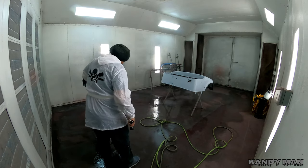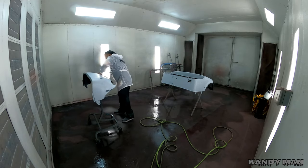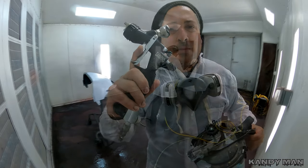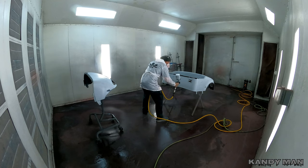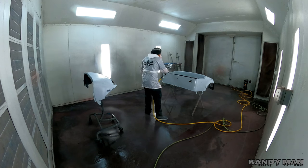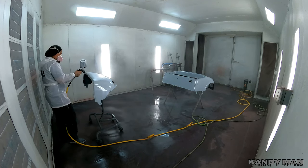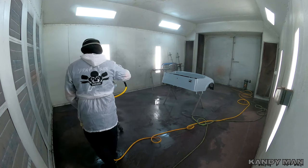To me it's the best tack rag out there — Crystal, even the old big ones they had were really good. I put my jacket on to cut down on lint, and I tacked it one more time. Today we're using the PPG gray sealer — it's a really good top-of-the-line sealer I used to use a lot. We put on one nice coat with the ProLite, which has the 1.2 head, at about 23 PSI for the sealer, and it puts it down nice.